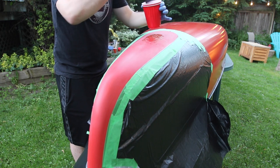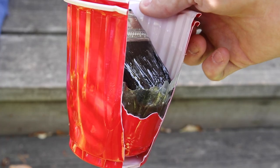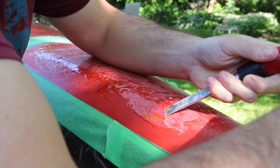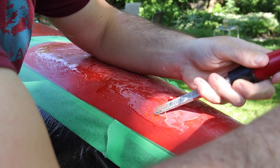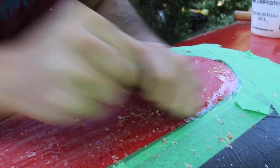So by the time I had finished working on the first skid plate, the epoxy had almost hardened for the second side. I actually ended up starting to apply it before I realized that it was starting to harden, and this required me to go back and chip it all off and sand down the surface again. Complete nightmare. So don't do that.